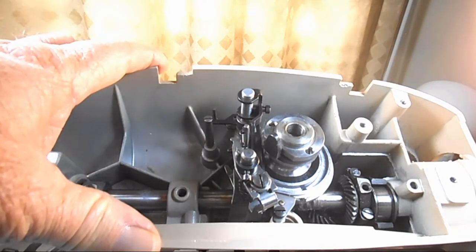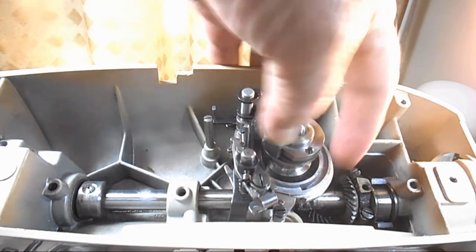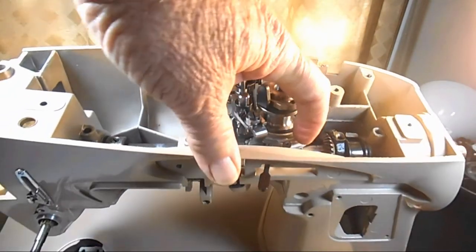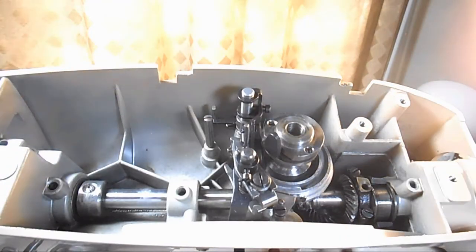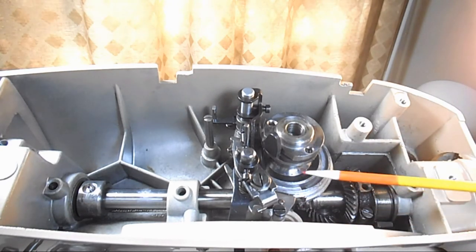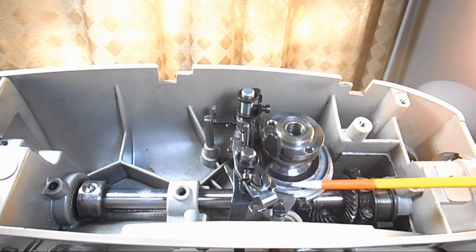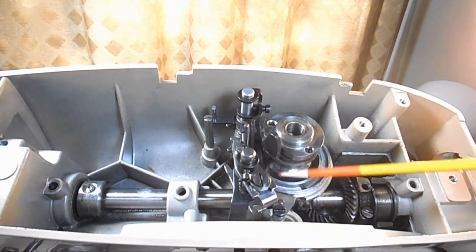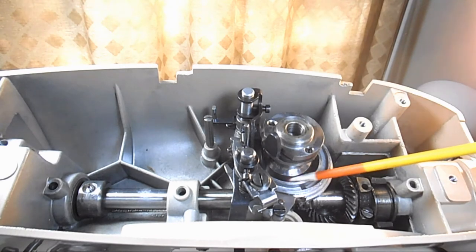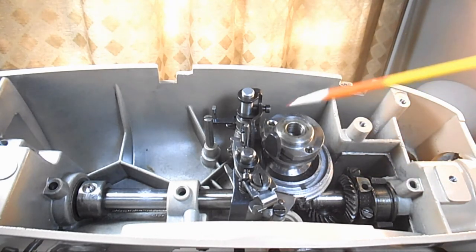So what I try and do is pre-treat the worm wheel area, all of these parts, but especially down here, the worm wheel area, and where it matches up with the worm gear on the main shaft. If you saw some of my videos, this machine was under maintained, which was okay for me. Nobody's husband squirted a bunch of axle grease in here and stuff like that. But I still would pre-treat this area and let it soak. And you can get small nylon bristle brushes in here if it's real bad. Then you saw my main wash and rinse in the bathtub.